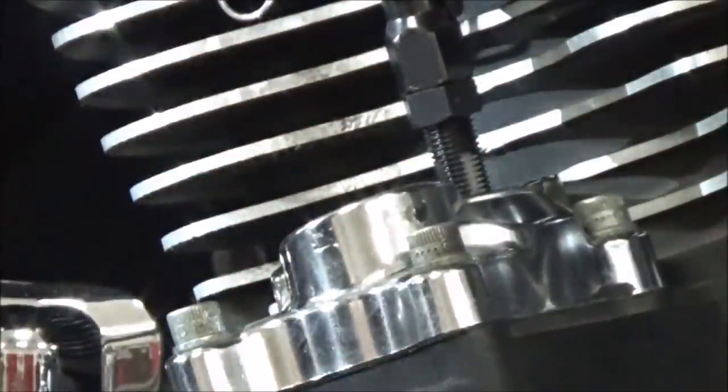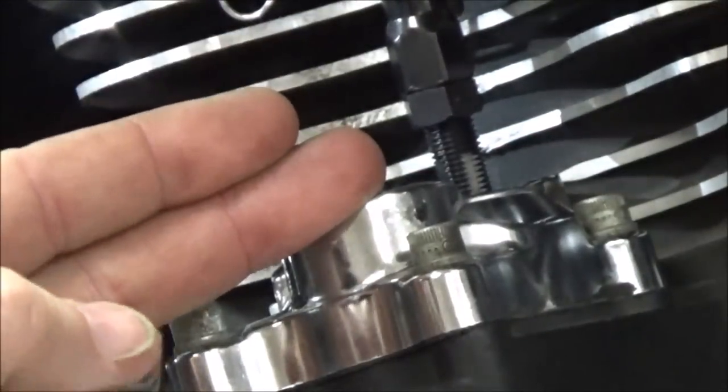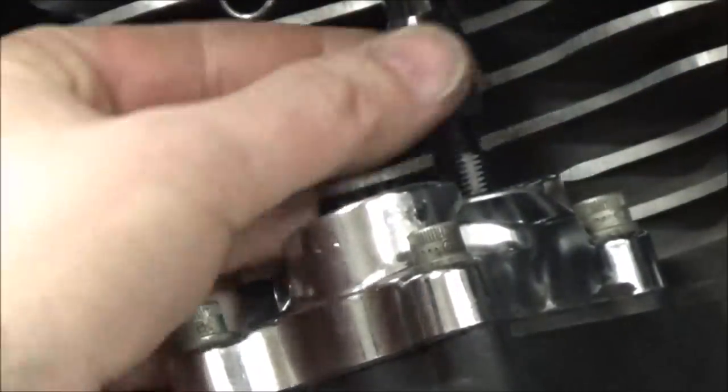You do not rotate the engine until I can twirl these. They say about 10 minutes in the instructions — you guys know from class sometimes it takes 20 minutes. I can't switch to this cylinder yet, so these are called bled down. I can rotate them literally by hand once they bleed down. Once I can rotate those I move it around, duplicate the process over here — turn the wheel over in top gear, watch the intake valve open and close, flip to when the piston gets to top dead center for compression stroke, adjust those, wait the 10 minutes, and before I put my covers fully on I have to be able to rotate these front ones by hand. We call that bleeding the lifter.